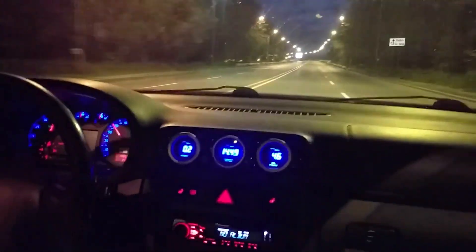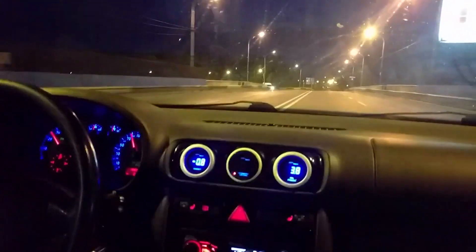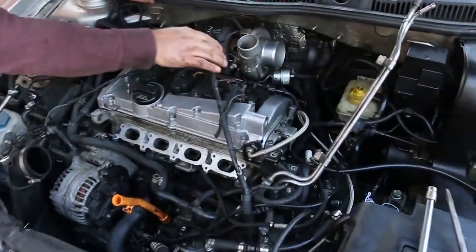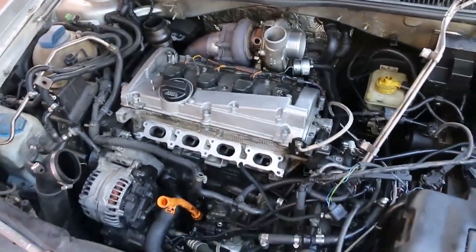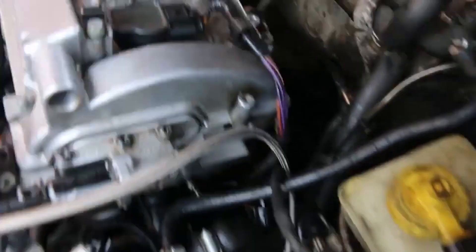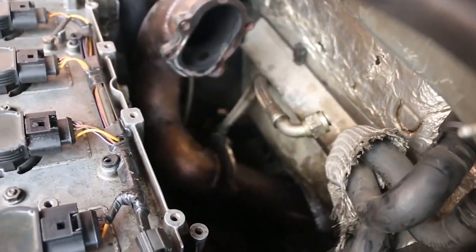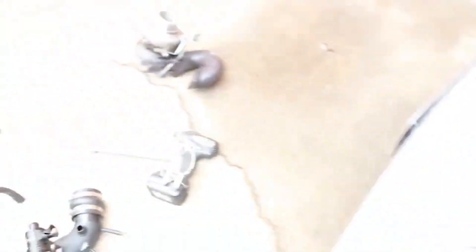For stage 3, you won't necessarily need all the motor mods just mentioned — look at your goal and upgrade accordingly. When going through stage 3 you want a big turbo, something like a GT28 or GTX28, maybe even a GT30. With that bigger turbo you want to include a three-inch downpipe, a high-flow catalytic converter or CAT delete, bigger intercooler, upgraded clutch, better injectors, an upgraded fuel pump, and switching over to a standalone ECU is also recommended.